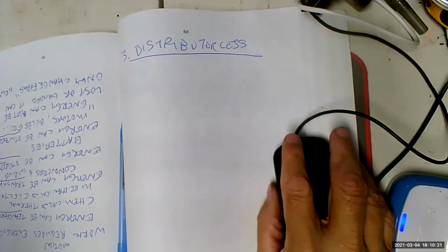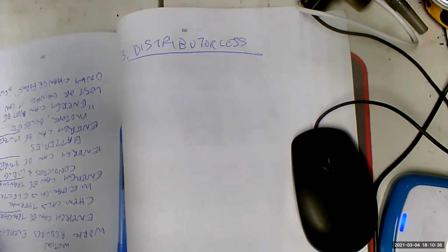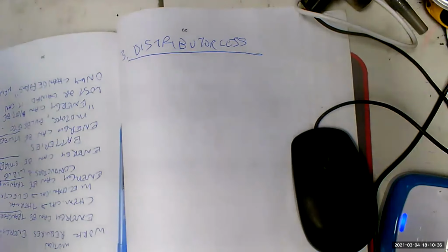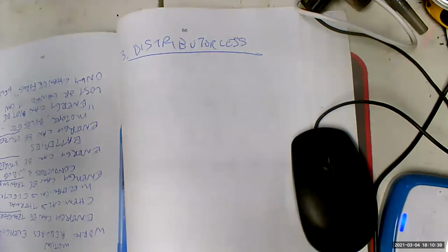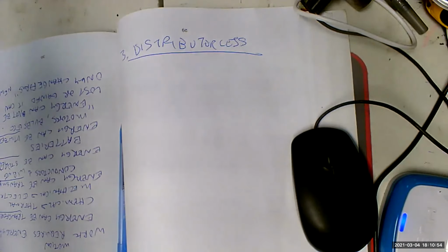Remember, the higher the voltage, the further apart we have to put everything. And that's because high voltages tend to jump. So you will see, for instance, in the National Electrical Code or in the distributor cap, that the higher the voltages are, the further apart we have to place everything. In fact, that's why the transmission lines that have 750,000 volts are way higher than the ones that are 500,000 volts, because we have to keep the wires further apart.